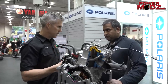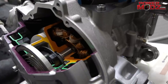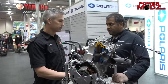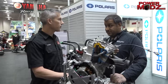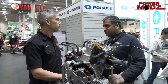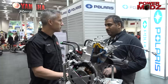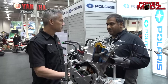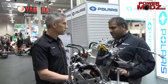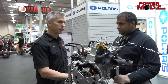Is there a difference in electronics? It is a new ECU. We have our power boosting regulator system — we first introduced that on the Titans last year. It just allows power through the whole RPM band. What that allows is things like hand warmers to work at idle better, headlights, and especially in this region people like to add those powered shields and heated seats. It allows for those types of options.